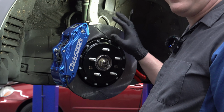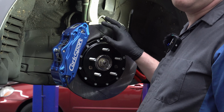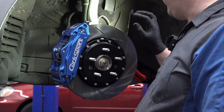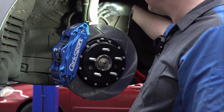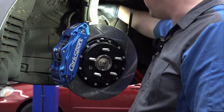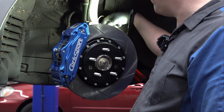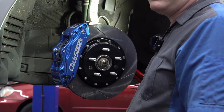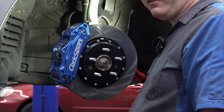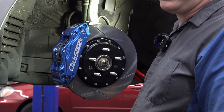Part of the reason why I got this is because with the older Mazda 6s, it's really difficult to find brakes for them. The hose itself fits fine, but the part where it mounts the hose to the car, just to hold it in place, not hydraulically, but just so it doesn't vibrate, doesn't fit on this aftermarket line either. So I'm going to do a little bit of black magic to make that fit. It'll be nice and safe. And again, it's not going to apply to you, so don't worry about it.